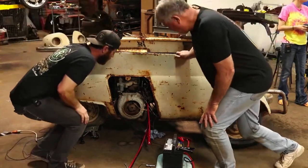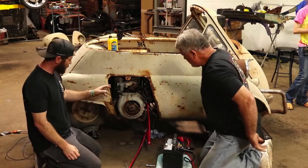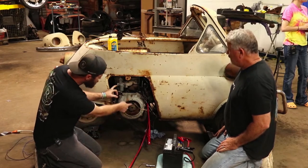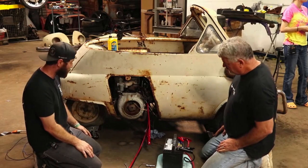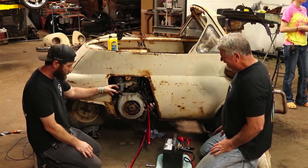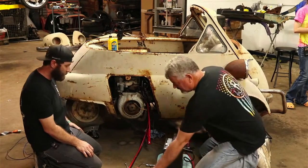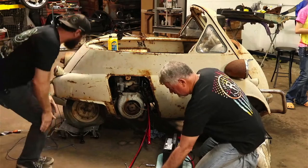So right now, we're only 11 minutes into the video. I think we're at the spot where we're going to go ahead and try to shoot a little carb cleaner through here and just see if it tries to sputter or what it tries to do for us. I could have showed you where it was sparking down here on the points, but obviously, y'all know that it is when it's sparking there at the spark plug. So that rubber band's kind of in the way. I can cut that if you want me to. Yeah. So I'm going to get a little carb cleaner and just spray up in here. And we may have to figure out something else on this rubber band if we get it to go, because we kind of need to put that fan back on there. So we had to remove a fan to get to those points yesterday. Let's get a little carb cleaner and see what she does.